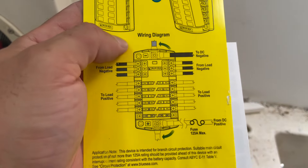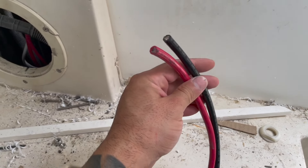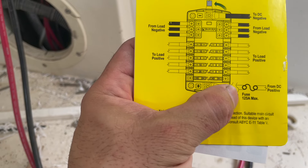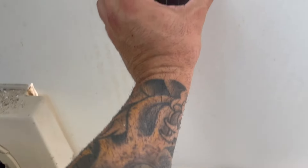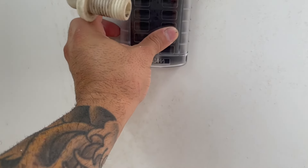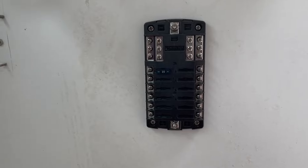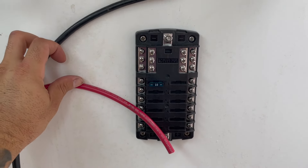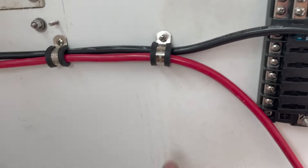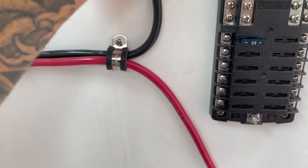While the cover is drying from paint, we'll test fit the Blue Sea Systems fuse box. Here's the wiring diagram — we have our negative and our positive. These are the wires coming from the 30-amp fuse in the back. According to the diagram it says 125-amp max fuse. I'm thinking we put the fuse box somewhere around here, up a little higher, nice and neat in the middle. We got our wires on the battery connected with stainless steel padded C-clamps, now we'll connect them up here and make them nice and even.